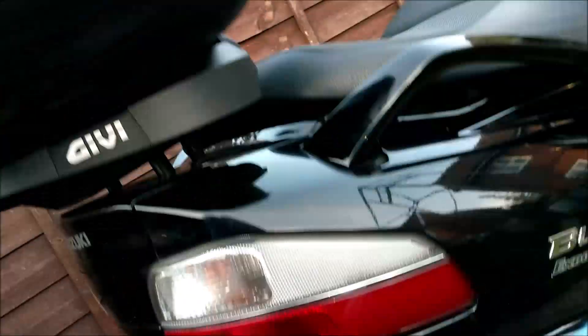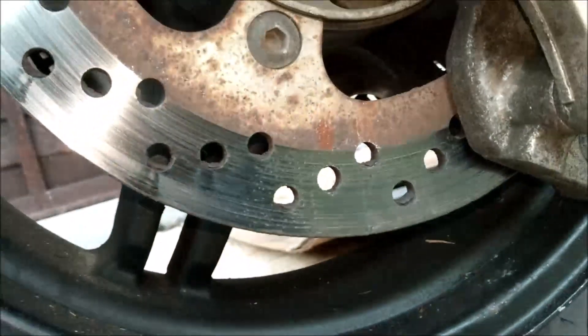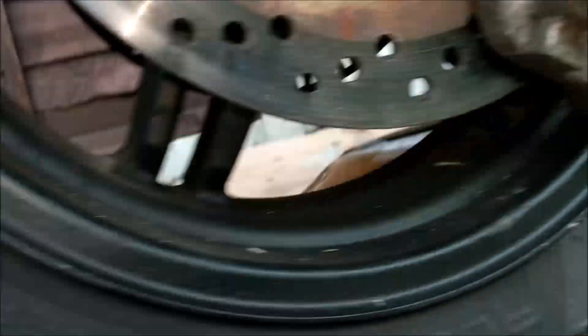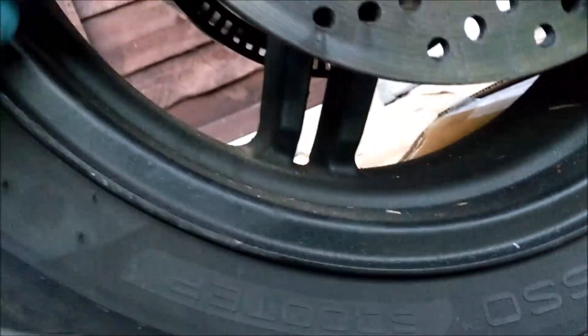Yeah, we had to give it proper beans because the rear caliper had seized. I was out here till all hours last night - well it took me about an hour. It was very dark, had the light on, and when I cleaned it I could tell there was something not right because the brake disc was burnt, which leads me to think straight away something sticky. See it - it's all purpley, if I turn that light off it's proper snarled and burnt.